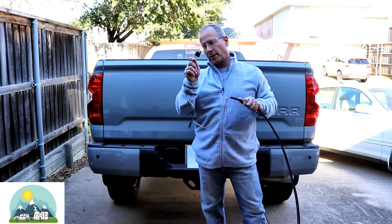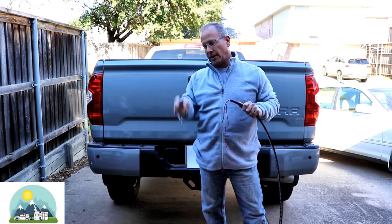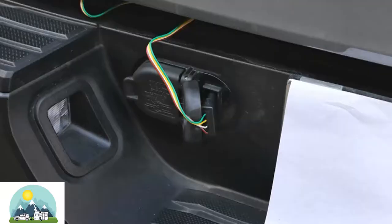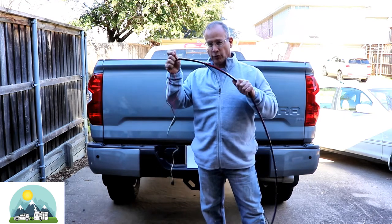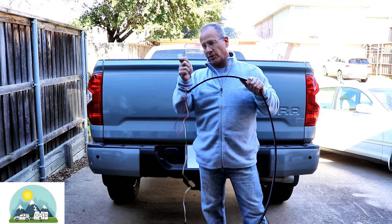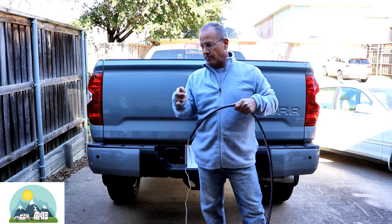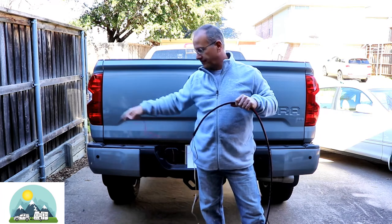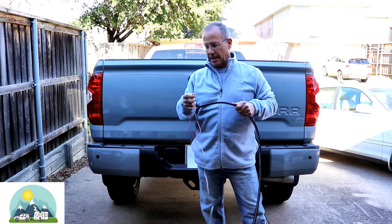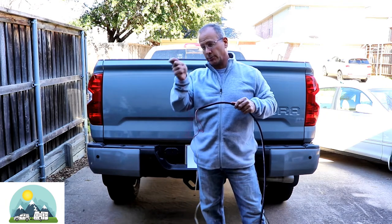The way these work is a four-pin adapter — you plug it in and you're good to go. The only problem is your wiring hangs down and doesn't look great. Also, this extra wire is for your reverse light; there's a reverse light on this bar too. If you don't install it, you still have your standard reverse lights, but this provides extra light. You'd have to wire it to your reverse light on the truck, and I'm not very mechanically inclined, so I'm not going to do that.